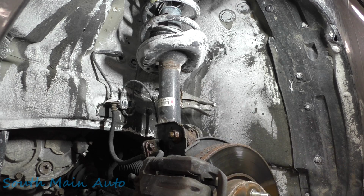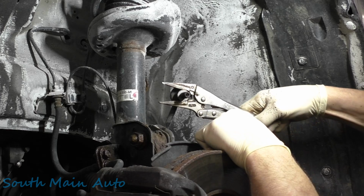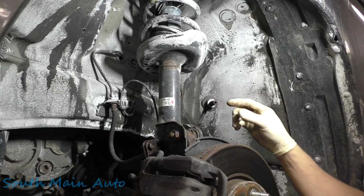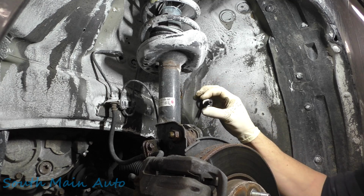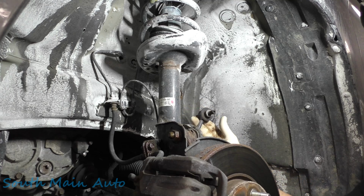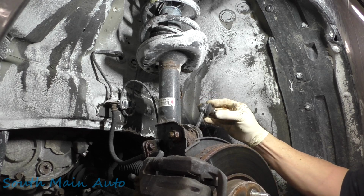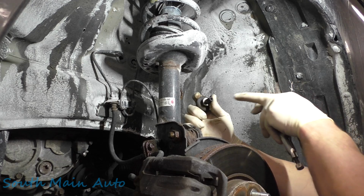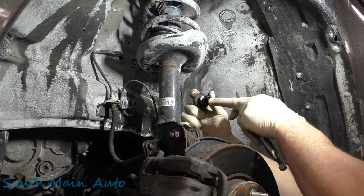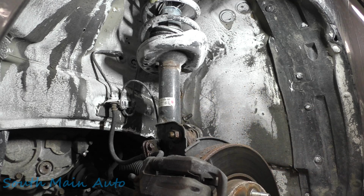It's important, and like I say, make sure when you're clamping it, you're actually on the metal ring there. Now, if it has aftermarket sway bar links in it, it may have flats where you can just get a wrench on it. The OEMs, like what these probably have, have been replaced before because they're still quite tight, or maybe they're original. They have a spot where you have to clamp onto it. Ideally, you would stick a 6mm hex in the middle, but forget about it.